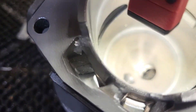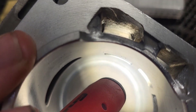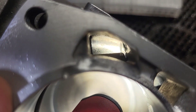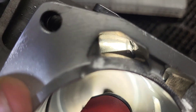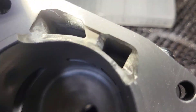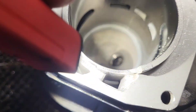One step on the outside is what I'm getting rid of. That hump on the inside has a lot to do with directing airflow through that transfer, so you want to leave that alone. And if that wasn't there, I wouldn't worry about that step, but I think it could be detrimental. Because really, that's about the same size all the way down until you get to that hump, and then it pushes the air back and around it. But I'm just blending everything in from here. Still have to get that step out of this side, and then put the cylinder on the saw.